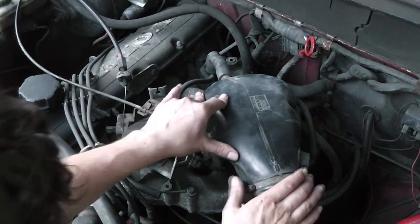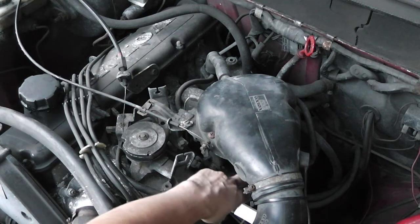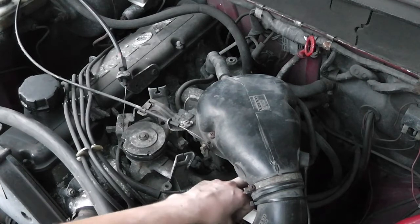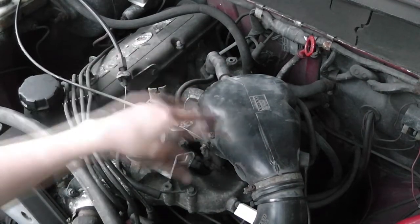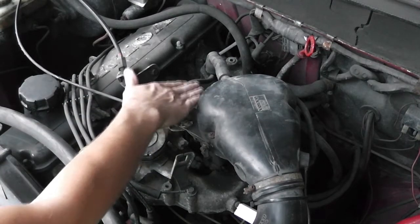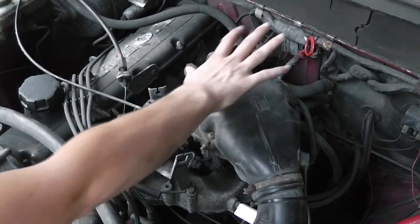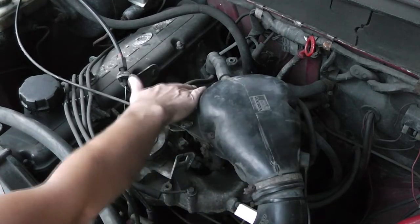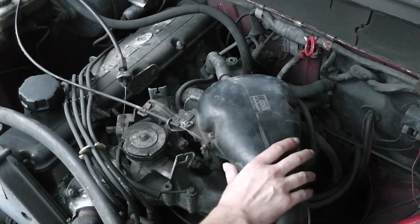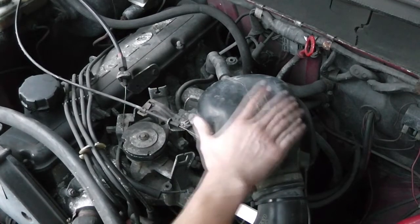I realised the whole top of the carburettor is loose. Hopefully all I need to do is tighten a couple of bolts and that should hold it down and solve the problem. I could tell it was going to be something loose because it was so intermittent. I cleaned the contacts on the wires and the plug, which is something to do with sensing or controlling the fuel mixture — that seemed to improve it but wasn't great. But it turned out it wasn't a loose contact, it's a loose entire carburettor.